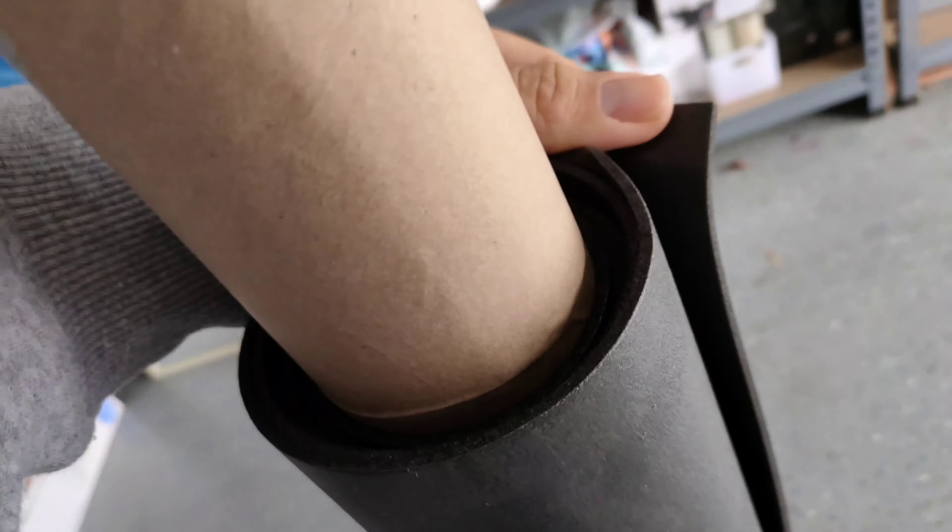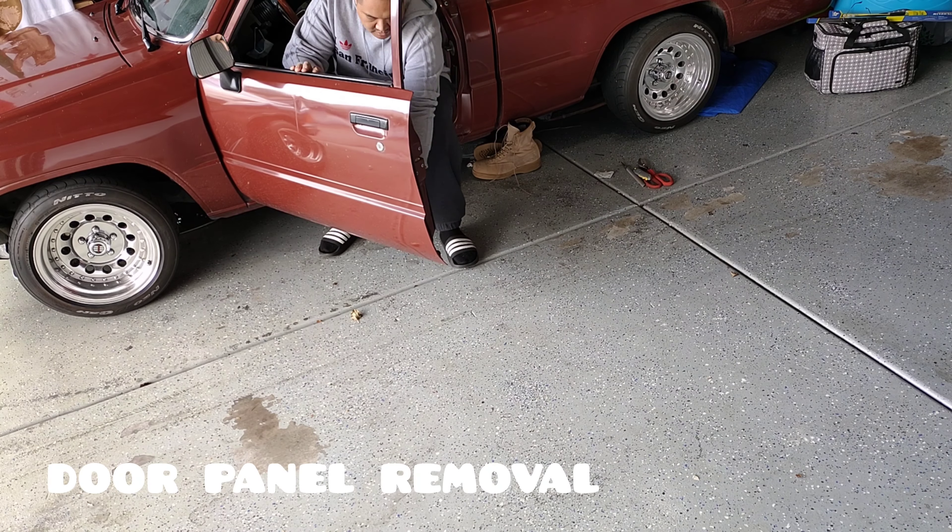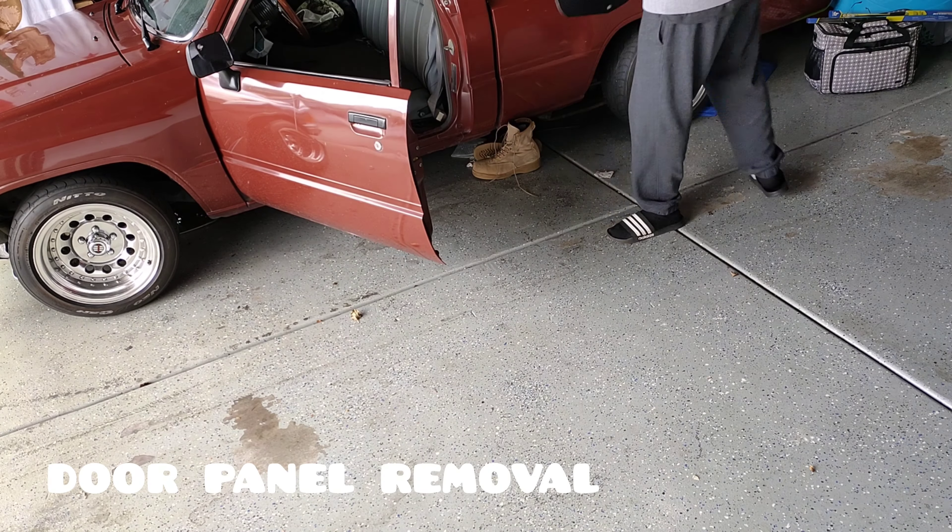What is up guys, today what we'll be doing is wrapping these door panels. I would do them out of 1/8th inch ABS plastic — I'm sure you guys know how to do these: just take the old one, trace it, trace the holes, cut the holes out, shape it. But I got the material right here, it's just a gray vinyl to match the dash, and I got the little foam padding behind it. It's a little windy, it's been storming lately. There's my van — so let's get to work.